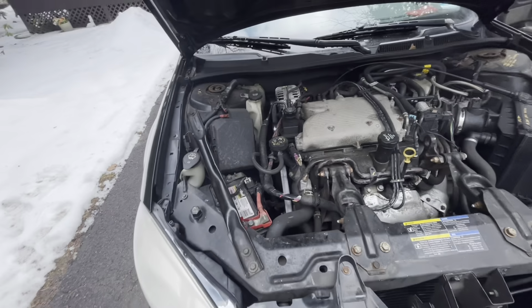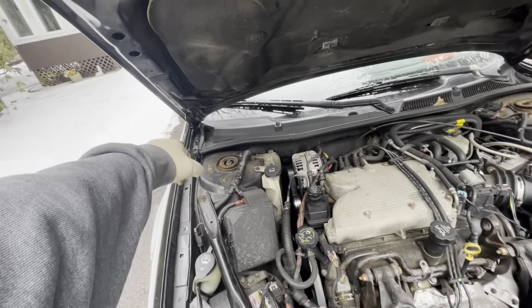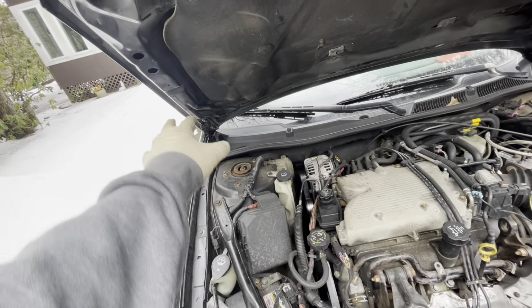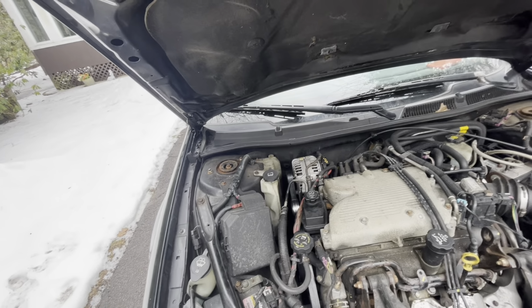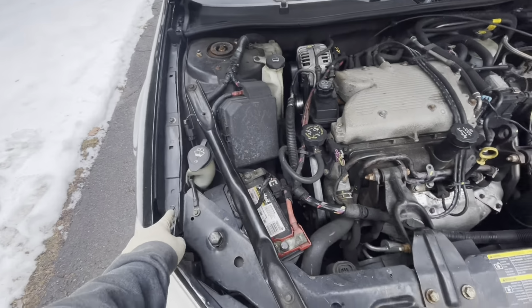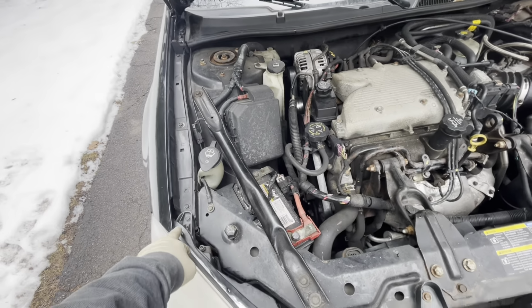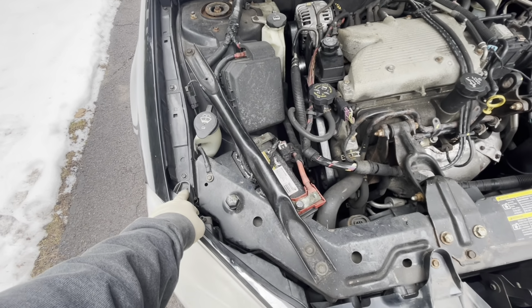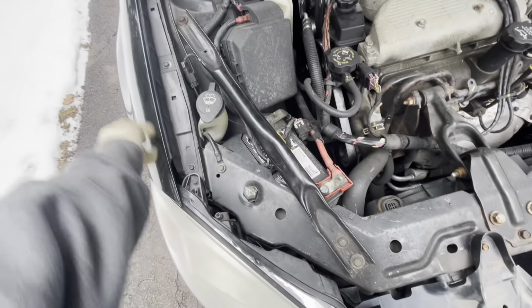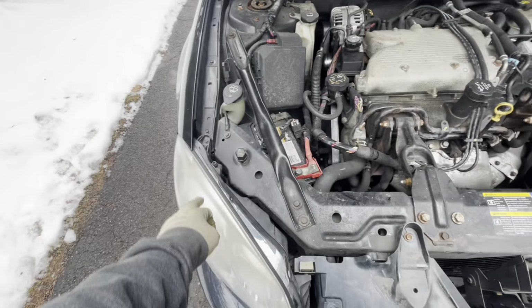And then I followed the marks on the bottom hinges of where the old ones were. And then we set the top on there, kind of loosely. Looked at it. And this side lined up perfect. This side, the gap was big, so we loosened these fender bolts up, shoved it in. The tab in the fender that holds the headlight was tweaked. The whole fender's got a kink in it right here. And we bent that out, shoved it in.